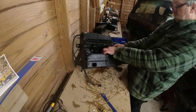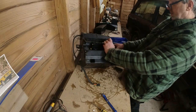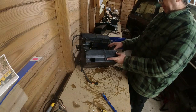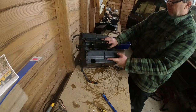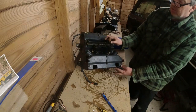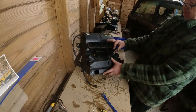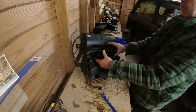So that's currently on screen. Just position it roughly in the right sort of place, just so I can find out whether it is. Push it right up. So I'm pushing the flap right up as high as it will go. And now it's right down at the bottom and completely blocked off, and right at the top. So that one's working as well. So that's the hot, cold, screen, and footwell, and fresh air.